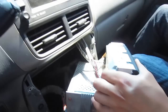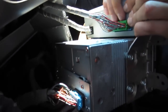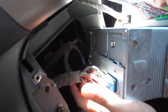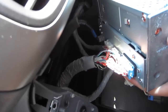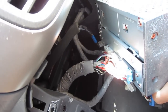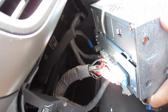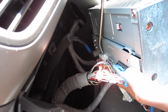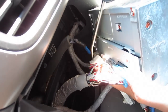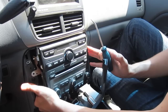So we're going to get to the back of this radio — that's why you need the clip removal tool. This is the connection that we're going to be using right here, and this is for navigation. That's where it gets the power for the touch screen, so that's why we're going to be using a Y cable on this radio. If you have a Pilot without navigation, you're not going to have this plugged in, but it's still a very similar procedure and the plug is going to look the same. We're just going to press it down and remove it, and we'll show you the kit how it is when it's pre-assembled.